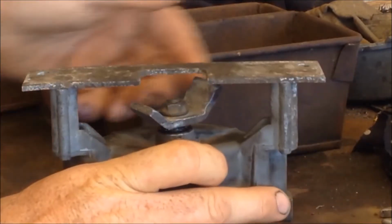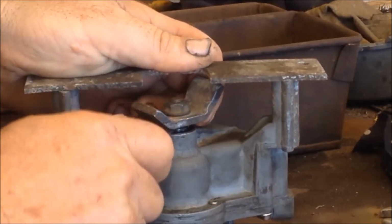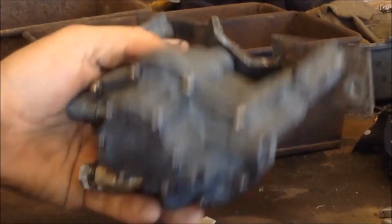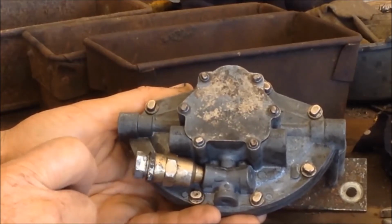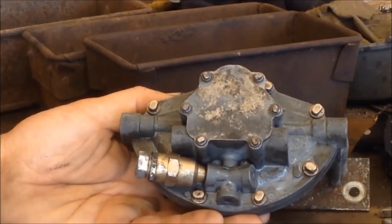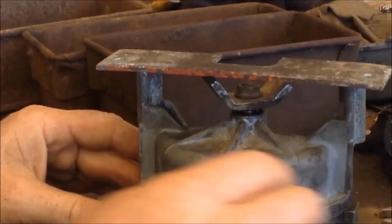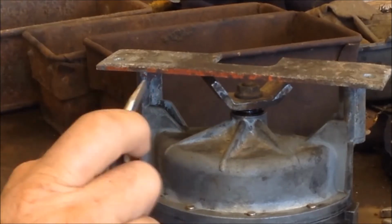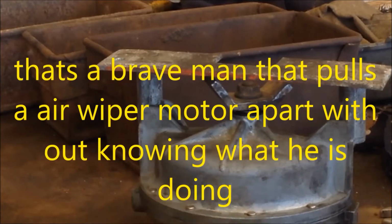Now what I've also found, I asked a few questions, and no one's really answered me, so this has movement sideways in it. And air runs out of here continuously, the whole time. Air runs out of this exhaust, whether they're travelling, whether I'm hanging on to the end, whether I've got it locked in the vise and I can't shift, air just pours out the end. And I reckon that in this housing where this vane is, the bits of rubber are badly worn. Now of course you can't buy seal kits for these, so I'm going to pull it apart and have a bit of a measure, see what I find.